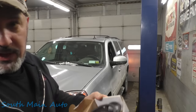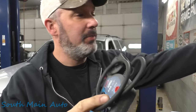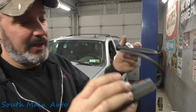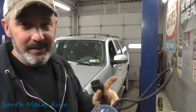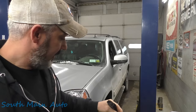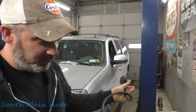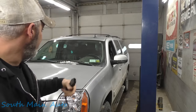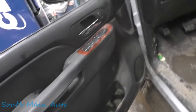We're going to grab the OTC CAN test box — it's an OBD2 breakout box. This is going to quickly tell us if we have power and ground and go from there. I've seen these as simple as just a worn-out data link connector. Sometimes we have problems with the inspection machine plugging in, but I assume whatever shop had it already fiddled with that. Alright, let's have a look.